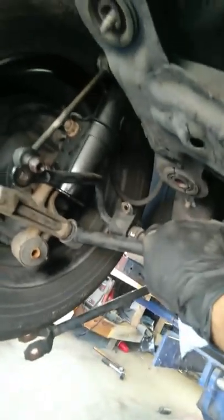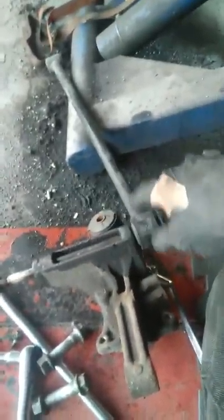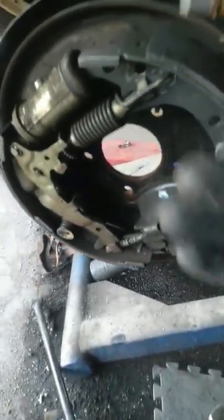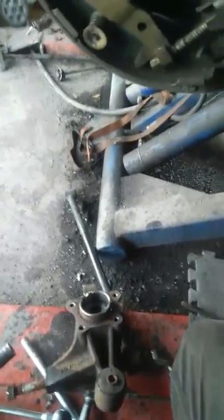The bolt is a complete bolt — I was thinking it had a nut on it but it's completely seized. So I have to use a press, heater, whatever it takes. But it's a simple spindle — you don't have to remove the brake lines, just take it out with a 22 millimeter and 14 millimeter, four bolts, push the plate out, and everything stays intact. Just free that bolt and same on the other side.